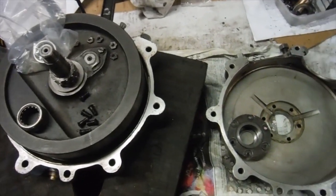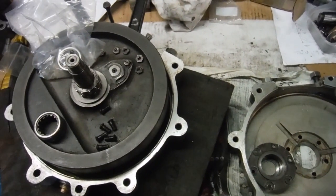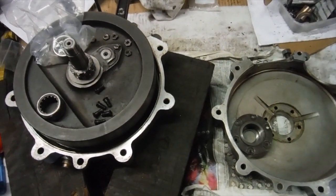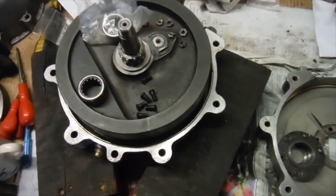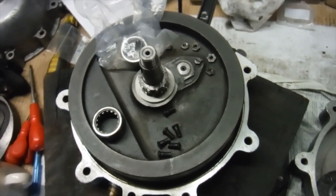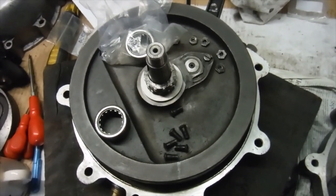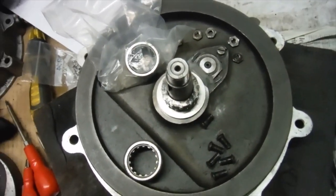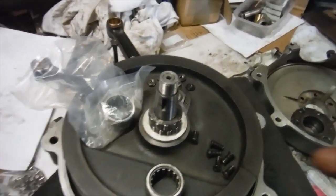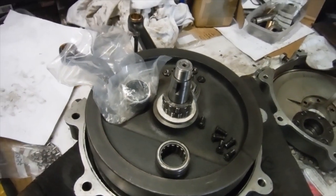This is a 1930 Royal Enfield 1000cc V-twin Model K engine that I'm working on to rebuild. So far we've had a new crank pin and big end rollers and hard eyes in the conrods, which I've honed in, and I've totally rebuilt the crankshaft with not only the new big end and crank pin and so on, but also a new drive side main shaft. The timing side main shaft was okay.